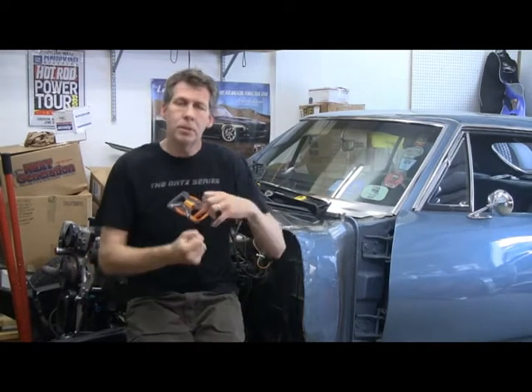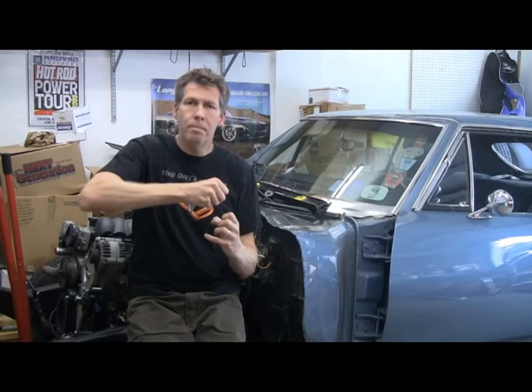The geometry of the driveshaft, transmission, and rear end is pretty important to make sure the car hooks good. I spent a lot of time with the old setup getting this thing to not wheel hop. With a four-link suspension like this has, it's easy to do because the pinion gear wants to ride up the ring gear when you jump on it, it wraps up the rear suspension and then releases — that's what gives you your wheel hop in the back.